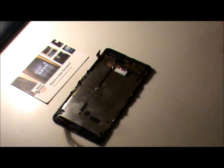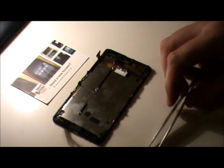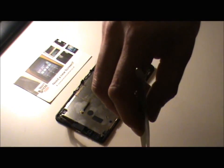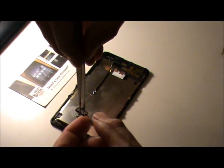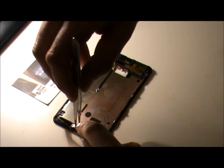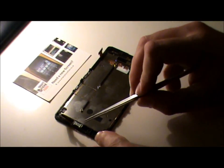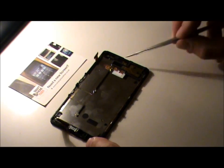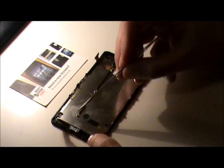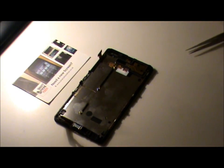Once you've got the LCD back on, the next thing is to put the earpiece speaker back into position. It's quite magnetic, so just get any dust off it, put it back in making sure the clips are facing down the body of the phone — the little springs should be facing that way. If they're facing the other way, it's the wrong way around. Get a gentle prod back in there and the earpiece is back in.